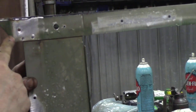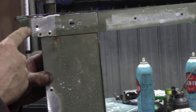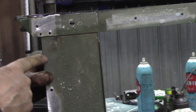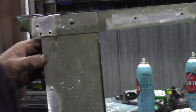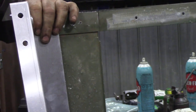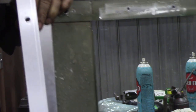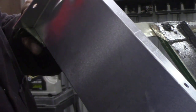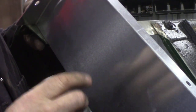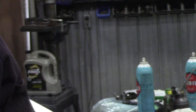What people can make a mistake with is this corner bit. Let me zoom in. See this bit here on this corner? There's an existing paint line. A lot of people make rookie mistakes and put the panel lining up to here - not good. What you want to do is when you put your panel on, make sure that this piece here is exactly on that paint line. Then it'll be all ready to go. So I'm going to try and get some clamps, clamp this up, and then we'll be ready for pop riveting.